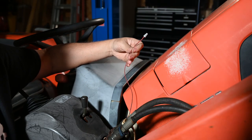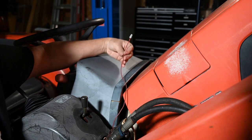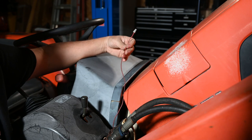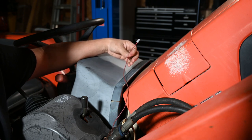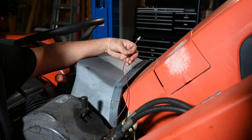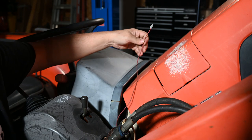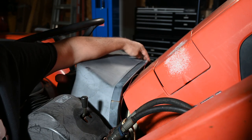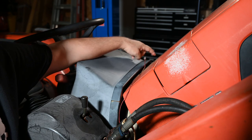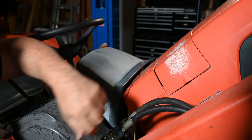So here's the original power line that I pulled off the ignition switch. It was about 12 or 13 years ago — I don't remember exactly how I did it, if I had to remove the ignition switch. But regardless, you can pull power off of any switched point, any switched wire. Since the fan has its own switch, you can even go with an unswitched connection directly to the battery, although I don't really recommend that. What the plan is, I'm going to run this wire across in this direction — I'm going to extend this one, then meet up with the actual wiring harness on the other side and follow it down and back along the frame. I figured that's a pretty well-protected position.